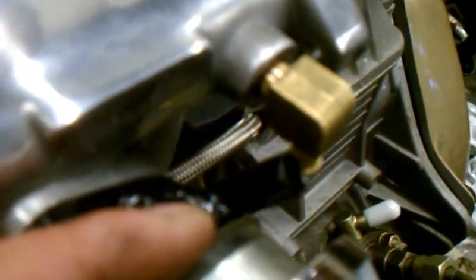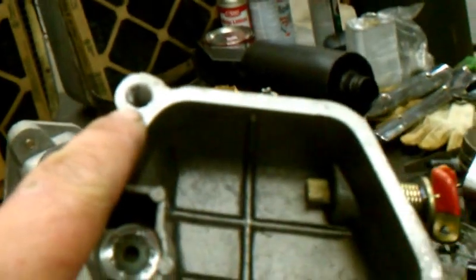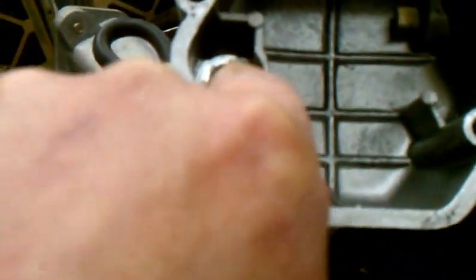On your intake, you'll want to have a nice tangential vacuum port for your PCV. Now, this engine does have a built-in PCV that is vented up inside here through the cap to a PCV valve underneath, right in there. You can barely hear it rattling, but that's your built-in PCV valve. And what you need to do is thread that little hole right there for a plug. What that will do is plug the boost pressure air going in here that will be coming up out of this, going through that and pushing against that PCV valve.